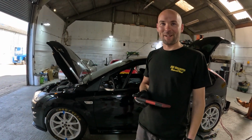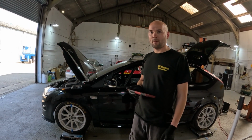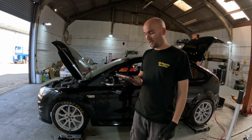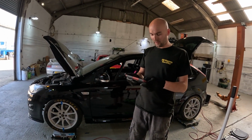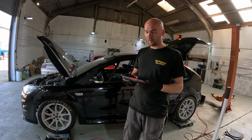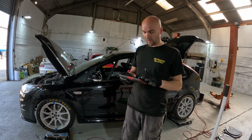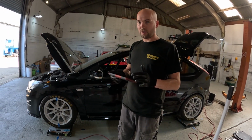It's just as the shocks went on, as they come factory fitted, and we've obviously messed around with the ride height and setting the droop at the rear. And then with all the alignment we've done on it, the car is 2.3 kilos across it diagonally. Beautiful. That's pretty mental. So it's quite a nicely balanced chassis, actually.